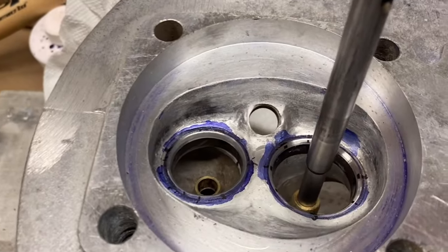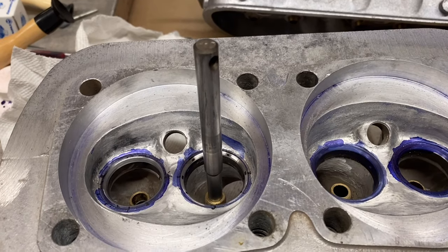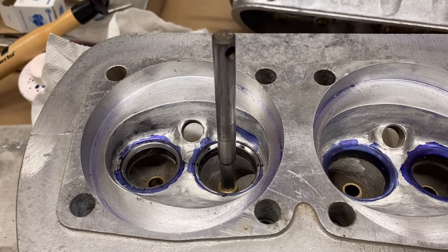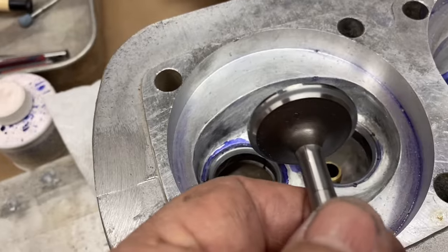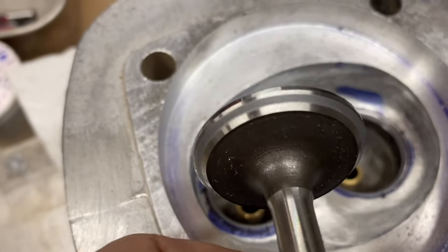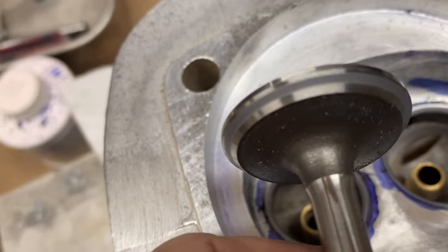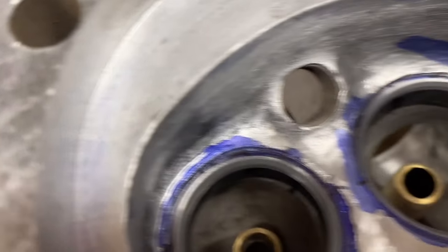So I'll go through and do that on all of them, and I'm going to lap this in. Then I will check the head volume — the chamber volumes — how many cc's. I'm looking to end up with between 7.5 and 8 to 1 compression, hopefully on the 8 to 1 side. I just finished lapping that intake valve in. You can see where the witness mark is from the lapping compound — that's about right where you want it, on the outer half of the face, not too close to the margin but fairly close.